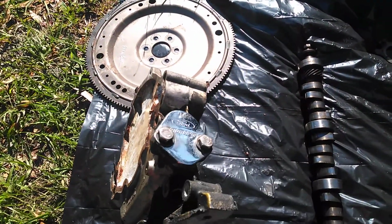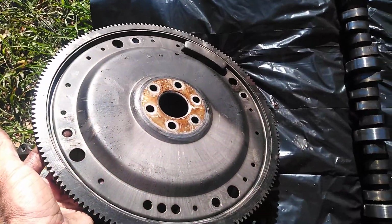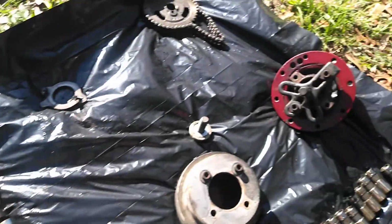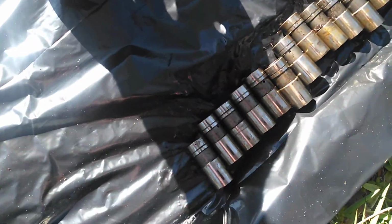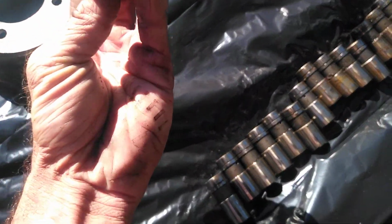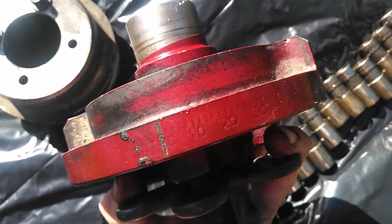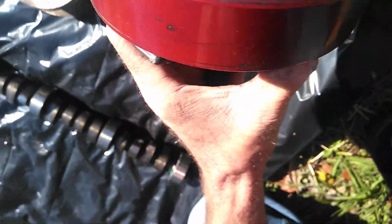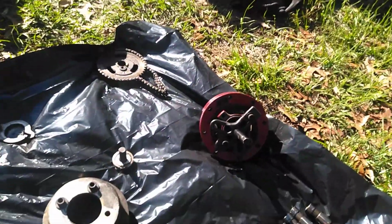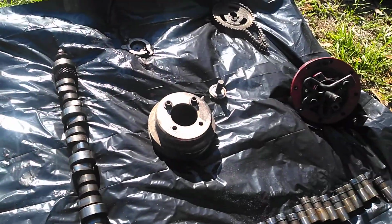Another indication that this was a stroker is that it's got that Ford Motorsports block off plate. This balancer is not factory, and it has not been on the car long. I haven't wiped it or done anything to it. I haven't checked the rods and crank yet, but they look promising. It had an aftermarket crank pulley, which I won't use. Another indication is this crank bolt, I don't think that's stock. I don't know if this is a stock unit or a harmonic dampener. This could be a stock 351 just painted. I'm not 100% sure on that, but it does have timing marks on it, so we'll have to check the rods and the crank to see if the rest of the bottom end is stock. But it already is starting to look promising.